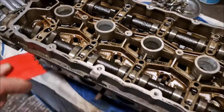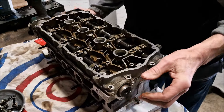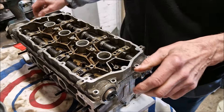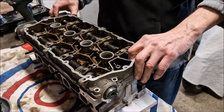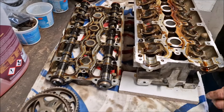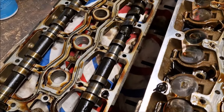So you've taken all these bolts out of here. Just being careful so I don't break anything, just getting that eased off. This is the front of the engine - cam belt end. There are the cams. See those red seals at the rear? So they're colour-coded - black at the front, red at the back. Are they different spec? No idea. But I did notice one of the packets - they're both nearly the same colour, sometimes a browny colour. The cams look all right, there's no damage there.